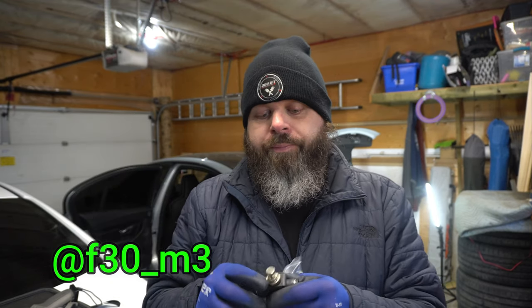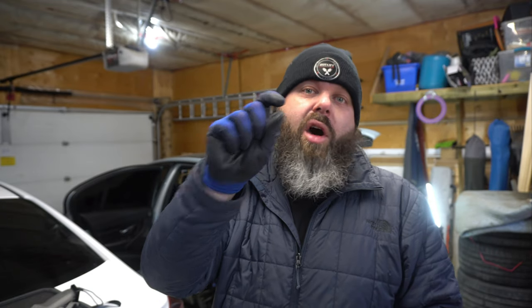When you have these installed, the car goes down flat. A huge shout out to Dan — he's the one that told me about these things. I was always trying to figure out how to get the car to dump level all together. Remember: if you're going to take fittings off of the plastic line, you need to cut about a quarter to three-eighths of an inch off of the end, because the groove it leaves in the line is where it will leak. Always remember that if you're plugging and unplugging, you've got to cut it or you're going to have some leaks.